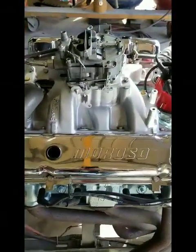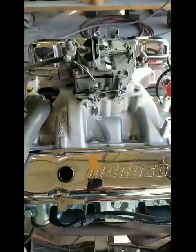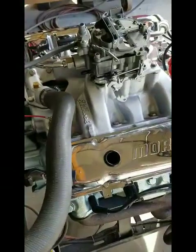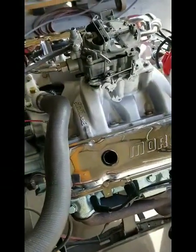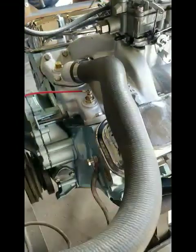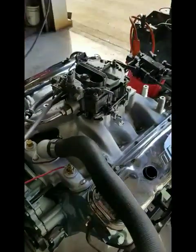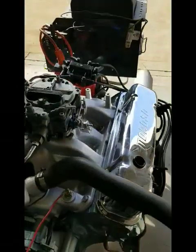It's got Johnson hydraulic roller lifters in it — this is a hydraulic camshaft. Compression is about 9.3 to 1. As reported, the heads flow roughly around 230 CFM. We are definitely getting better with our porting and valve job. This thing rips through the RPMs.